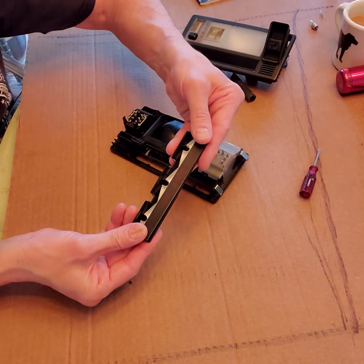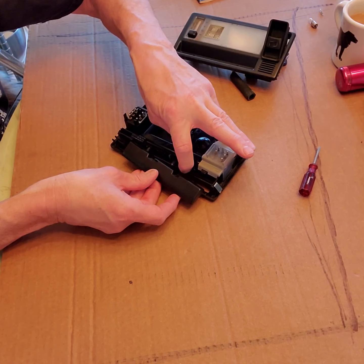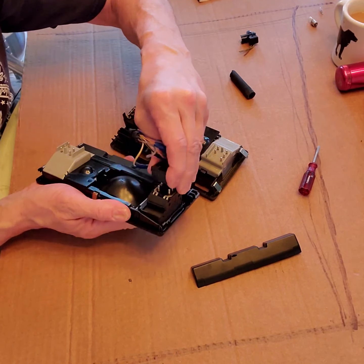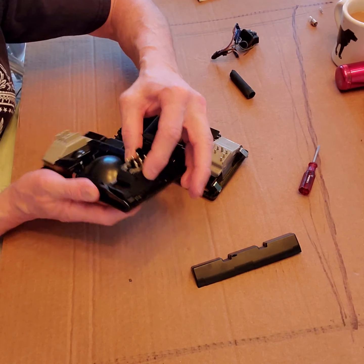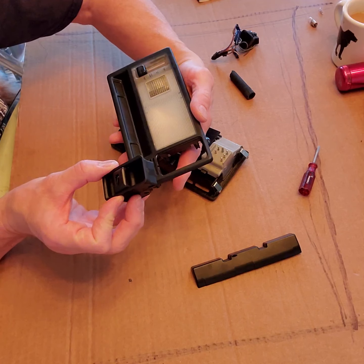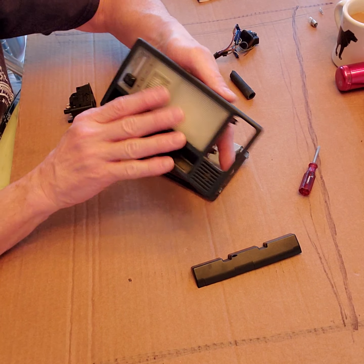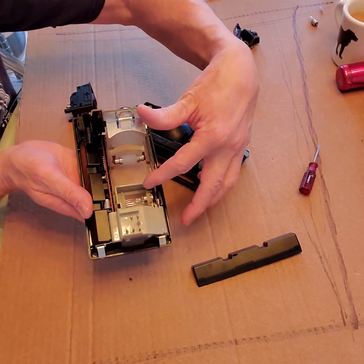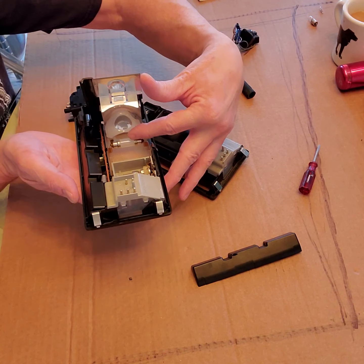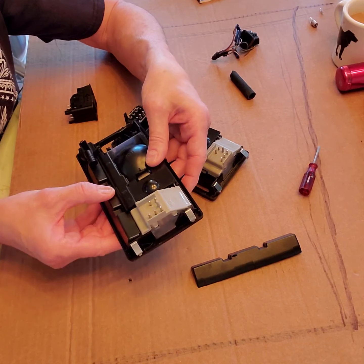That's how you get that guy out of there. Then you stick this piece back in and it clicks with the indents on the tab sides. These tabs are super brittle and might break. Here's the wiring harness — when I pulled this out, the two little tabs just shattered. It's 30-something-year-old plastic. This particular housing has fewer cracks and has two lines intact, so I may try to make this one work. It's still got the original bulb and an LED bulb. I don't want to go bright white 6000K — I'm going to probably go 5500K to keep a little bit of an eighties-appropriate glow but with a higher level of light overall.